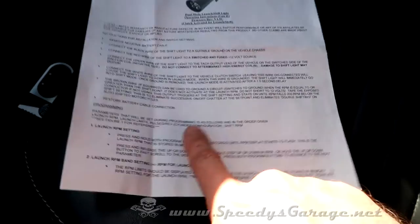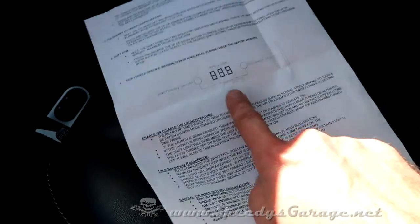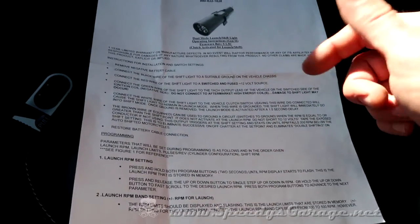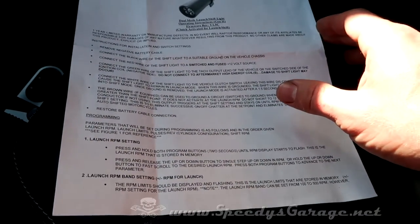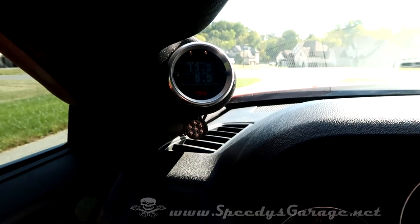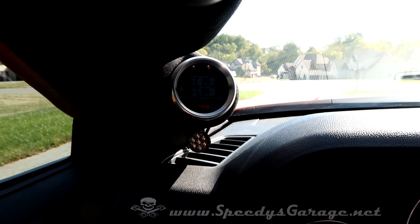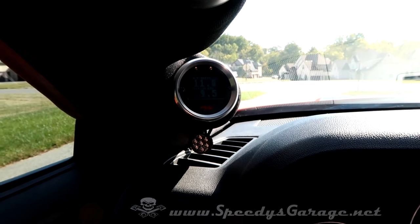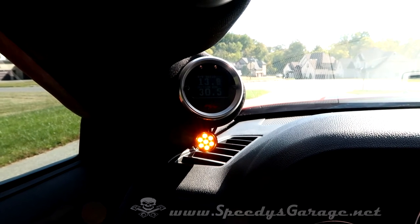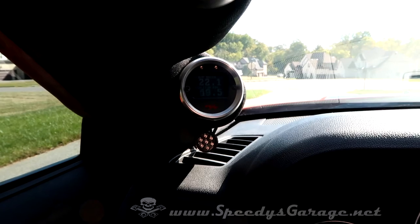Just fire it up and follow your instructions to set it up. You push a couple of the buttons on the unit — it puts you into program mode. Hold them down for about a second to a second and a half and it'll advance to the next setting. I've set it to 2000 RPMs just for the demonstration. Works great. And then the launch feature — if you push the clutch in, I've set it to about 3500. When you're on, it'll stay lit. When you're below, it goes out, and when you're above, it flashes. Very handy.